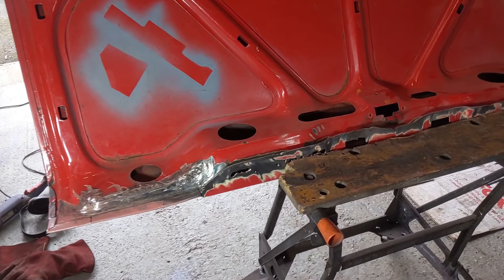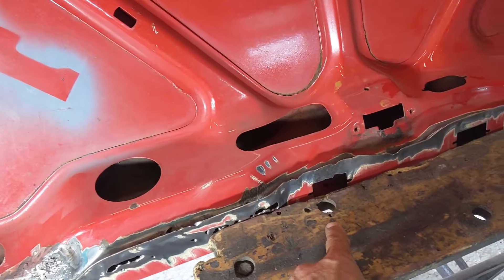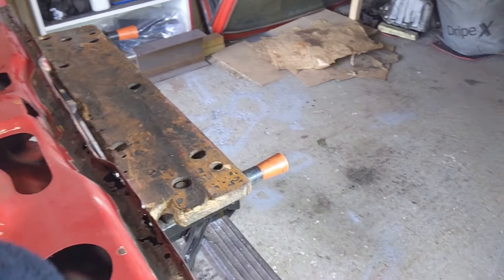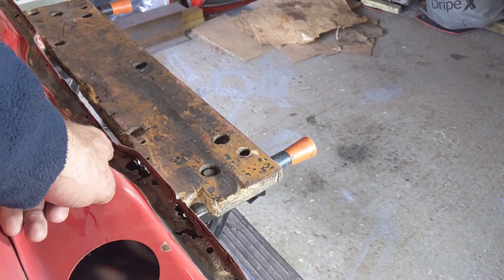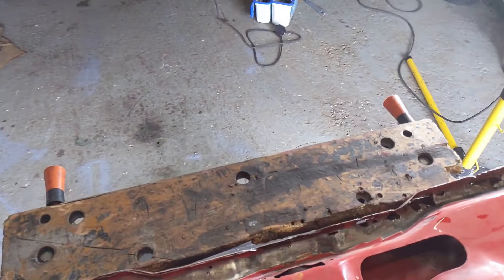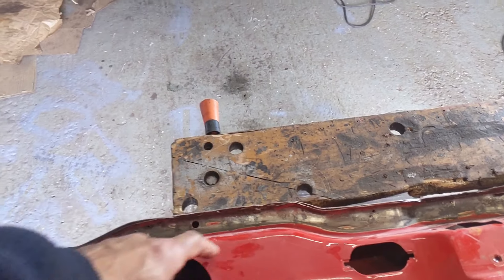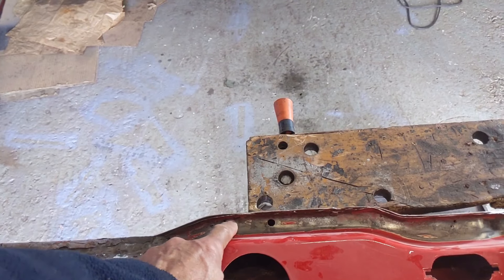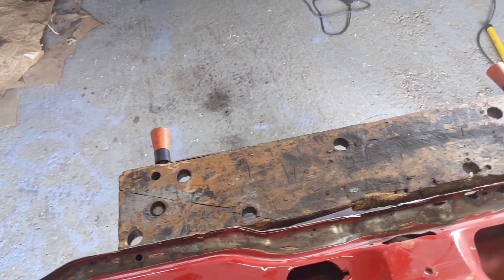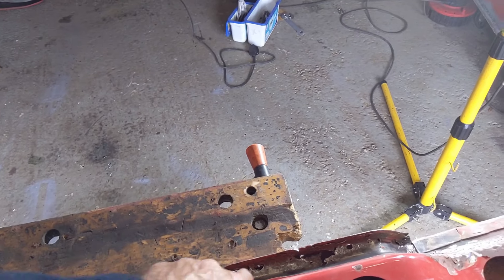Okay, it's Friday. I've just been cleaning up along here. I've got a section here which clearly we're going to have to take out. Looking along the edge, it's quite pitted and holey - lacy all the way up here. On the other side it's not so bad. The metal has come away a bit here and a bit here. The only holes we have are tiny pinholes - two here, one here, and one here. I'm going to try plopping a spot of weld on those to fix them up, and then I'm only going to replace the section in here.